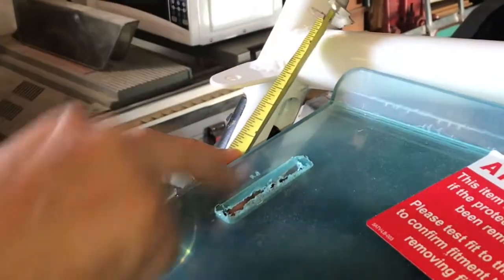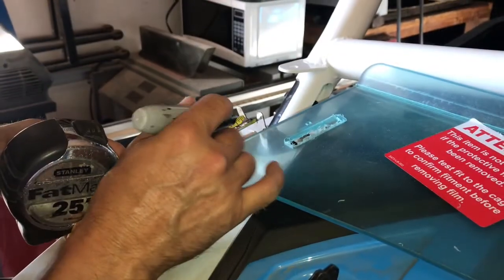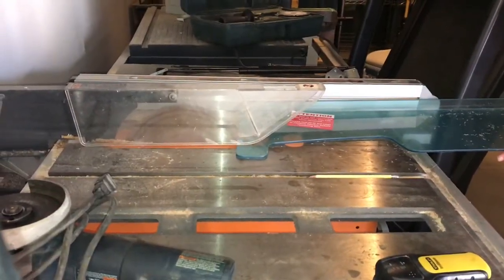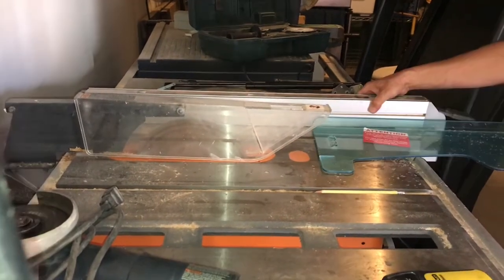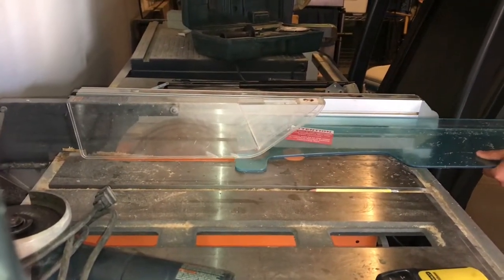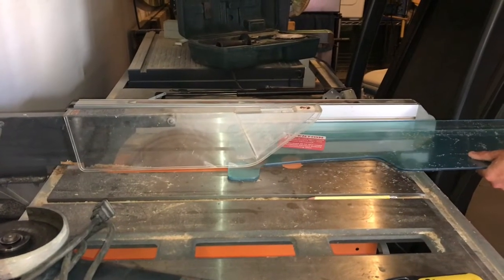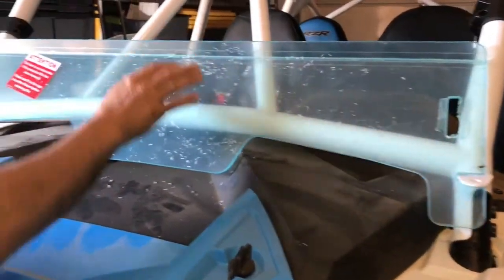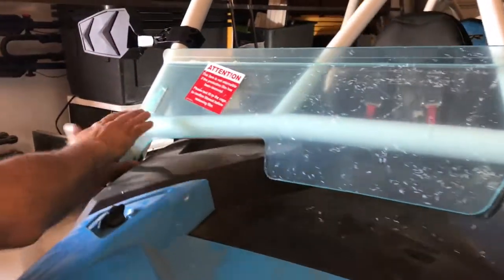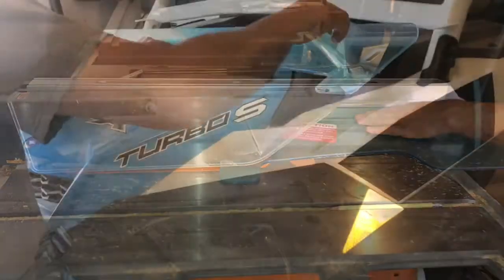Basically I'm marking from where that bracket is going to sit down — we're at about two inches. So even with the bottom of that bracket, I'm going to mark it at two inches. I was able to cut this windshield on my table saw. I moved the rip fence to cut it at two inches, then moved it over a little bit, cut it again, moved it over, and cut it again. I've cut plexiglass or acrylic plenty of times with a table saw and never had an issue — nothing special about the blade, just a fine-toothed wood-cutting blade. The only time I've had plexiglass crack is when I was really close to an edge trying to take a sliver off. Make sure you take your time with the cut — do not rush it. I would cut a little bit, go and try it on the Razor, and then cut a little bit more in whichever direction I needed to widen it.